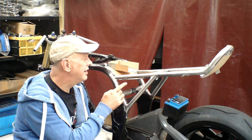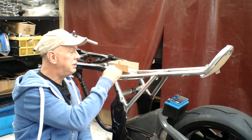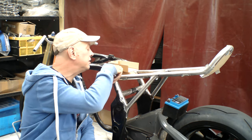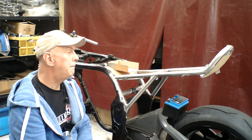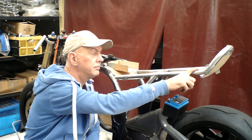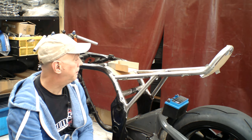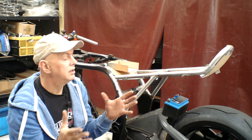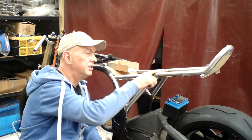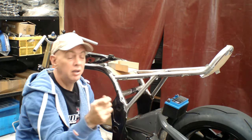The tray, yeah, I'm going to make myself something else as well. The trays are going to be inset. This front one is obviously going to be probably the more awkward one, just because of the way it snugs in around here and everything. But what's going to happen is that the back one is going to be welded up to the inside of the frame. Then this one and this one, I'm going to basically fold them up, set them in, and then slug weld them down the sides and stuff. So it'll be its own box with welded corners. Nothing's going to get in there, and it'll be attached to the frame by weld.